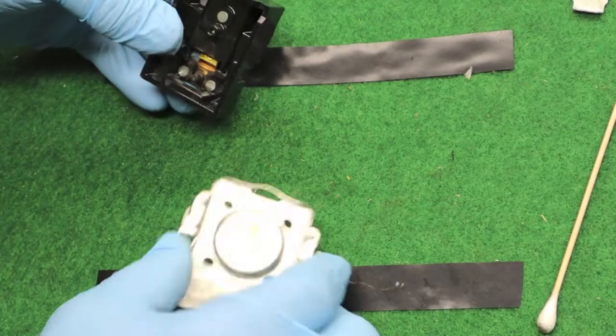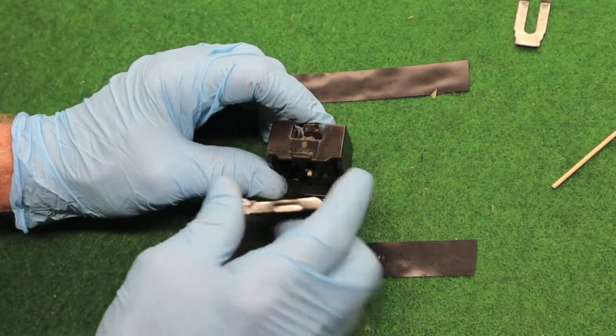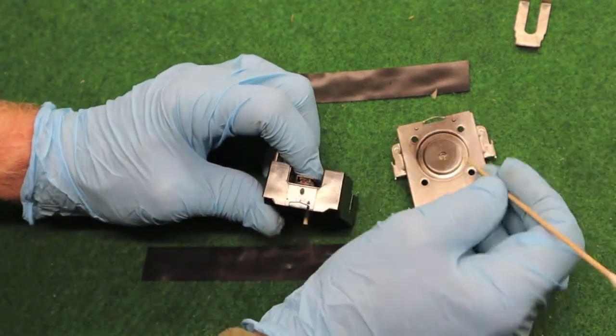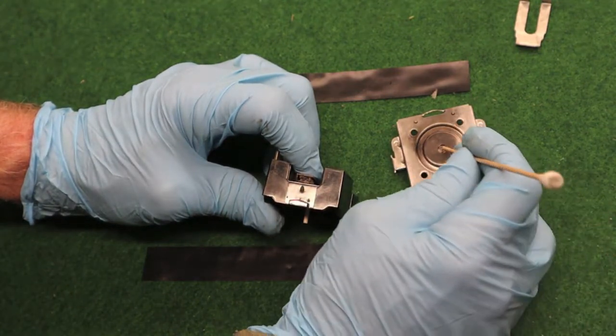Maybe 30 thousandths. This is in a cold water state. So in a cold water state, buttoned up like so, we're normally closed. We have current flow, we're heating up water. The bi-metallic disc opens at 135 degrees or whatever you set it at.